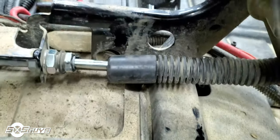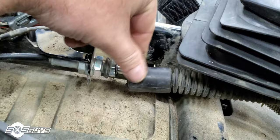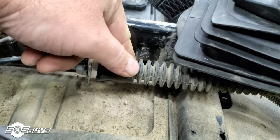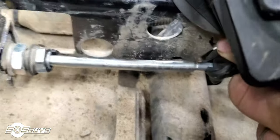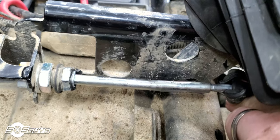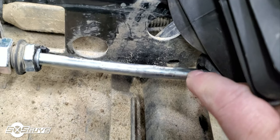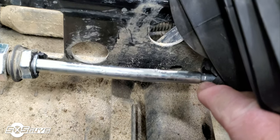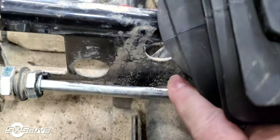If we take a look at the boot down here — it goes from the shifting pivot all the way back to where it meets the chassis. This can be cut here and zip-tied back down for an on-trail repair. But if you look back on here — hard to see on video — right about there is a pinch point. At some point the shifter was jammed. The primary cable metal sleeve ends just right behind this point, and when it got jammed into park it caught and pinched the outer sleeve, and now it's binding.